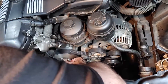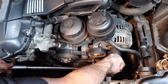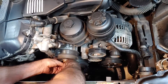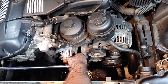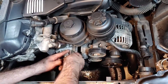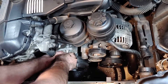There are four 10mm bolts securing the water pump pulley. With the bolts loosened, the main belt can now be removed the same way as the first belt by using the T50 Torx socket and a breaker bar. Completely remove the four bolts and set the water pump pulley aside. There are four more 10mm bolts securing the water pump to the engine. The water pump has a pretty tight seal, so you might need to wiggle it or gently use a plastic mallet to break it free. This will release the last of the coolant.